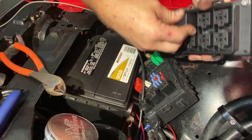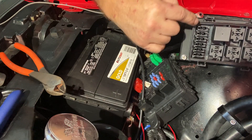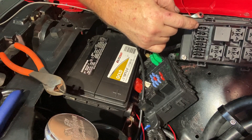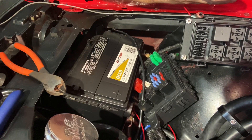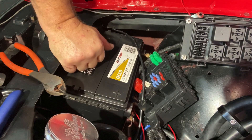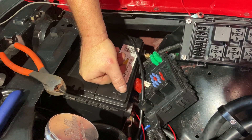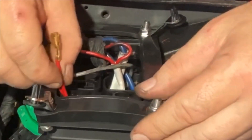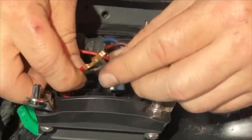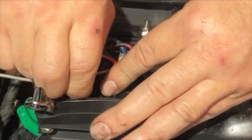That's the first one - this is ready to now snap in, like so. Bam, there we go. Now the next one we're going to wire up two pins for the fuse for number two relay, and that's going to be for the pusher fan later on when I do the LSA. That's going to be needed, which is why I went ahead and did this now to prep - a couple of spal fans going to sit in front of the heat exchanger, so I'll be all set. We'll have some heavy gauge wire to carry the amperage. Now that's snapped in, I'm going to go ahead and snap in the other side - that's for a future fuse.